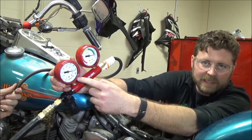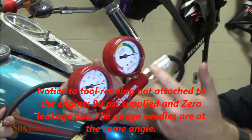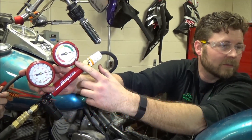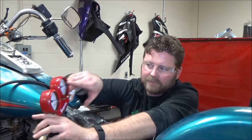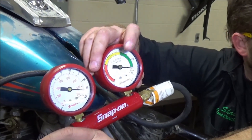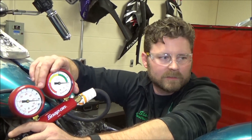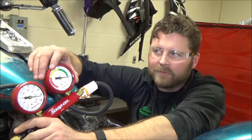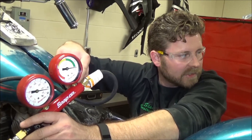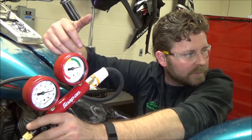When this won't hold the inlet of, say, 90 PSI like we're doing, it's recording how much of that is leaking on the outlet side — hence the idea of the leak down tool. So what did we end up with this time? Let's just say 45. If we're at 45, on an old bike if we have 20% leakage we'd say yeah, it'll run but it's probably due for some freshening up. But if I'm at 45 and we're leaking 5% at the spark plug adapter, and this gauge is leaking 5 or 10%, you could have a bunch of factors where the motor might actually be at 20%.